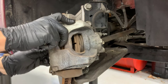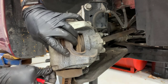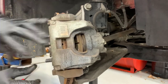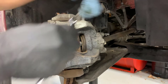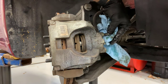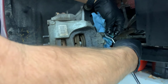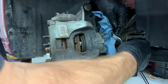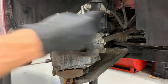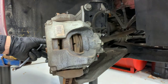I'm reinstalling the retaining clip here — this is the last piece I need to put on for my brake job. It's kind of giving me a hard time, but if you monkey around with it a little bit it'll go on. Now that everything's together I'm going to loosen up the bleeder screw again because I want to make sure I did not introduce air into the system. I'm simply opening the bleeder screw, letting the fluid drip out, making sure there's no air in that part of the system, then tightening up the bleeder screw very lightly — they do not take much torque at all. Put the cap back on; that's part of having a professional job.